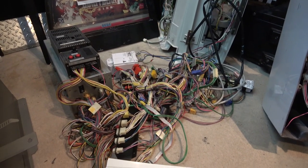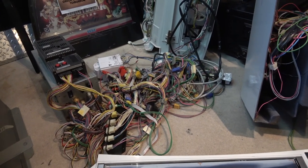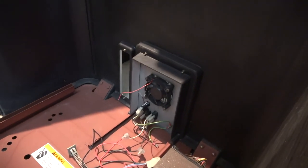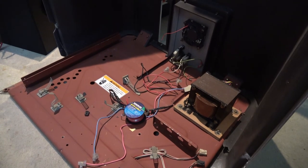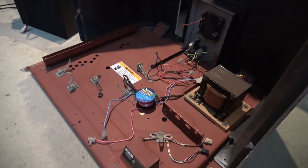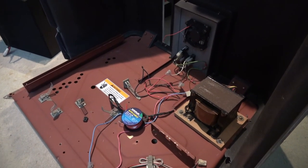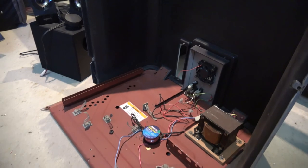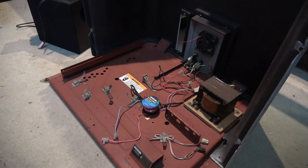The power supply is different from the one that's in the Blast City — not that it's obvious, but that's the way it is, and we don't have the original Blast one. Some of the casing fittings are a little bit different. Ideally it would be better to get a Blast power supply in here with a step-down transformer, but we're going to do it the hard way. I'm going to try not to break up any of the existing cabling, in case I want to convert it back with an original Blast power supply if I can get hold of one.